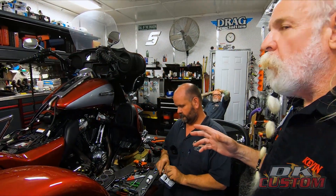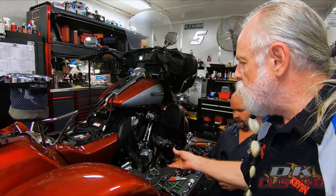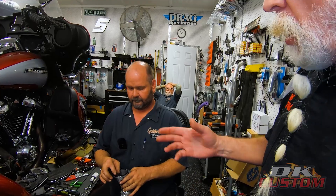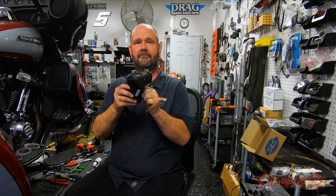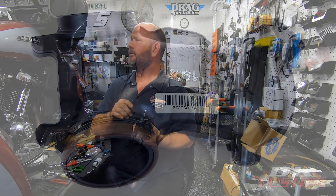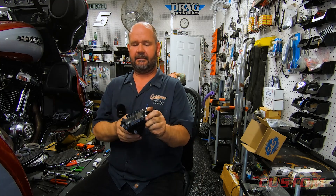What I didn't plan for, and thought of years ago, was replacing this plastic intake. We've already got the intake out. I'm going to let Jamie talk about the problems with the factory intake and the benefits of putting an aftermarket intake in here. Pretty obvious the problems with the factory intake — plastic. These things are absolutely notorious from engine heat for warping and melting around the flange area and causing an intake seal leak.